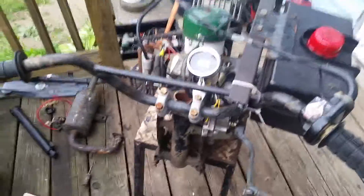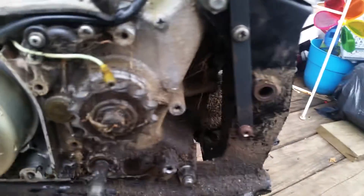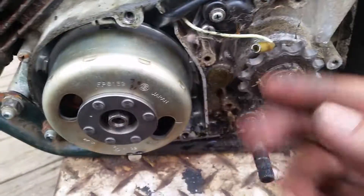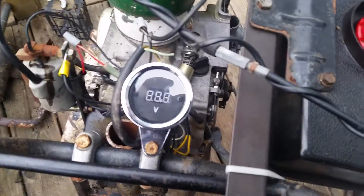We're going to simulate your bike setup. The 12-volt relay coil is mounted back here on a piece of plate stock — same stock I use for my coil upgrades and ignition modifications, about one-eighth inch thick. We want to see 12-plus volts on the gauge. Realistically, you're looking at 13 to 14 volts — an automotive charging system at 12 volts would put out around 14.5 volts, and that's what we're shooting for.